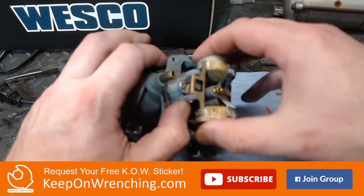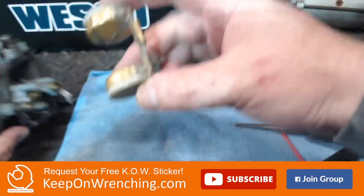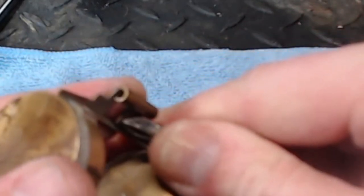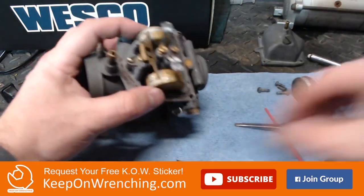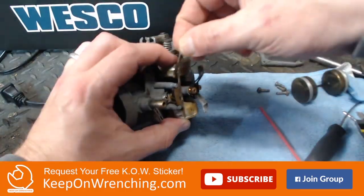Since you're probably going to have to make an adjustment — and this one is definitely super high — there's just a pin inside of here. You can grab a screwdriver and push that pin out. Then a little pair of needle nose pliers come in real handy. Pull that out and your float is going to come out. What you're going to look at is that tab. My tab needs to go down because I need these floats coming down, so I'm going to give this one a good push in. Then you throw these back on — and don't lose that pin because you're going to need it. Go ahead and put this back together.